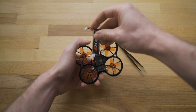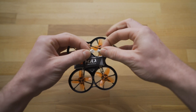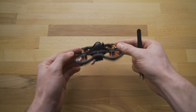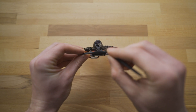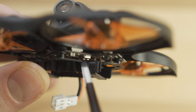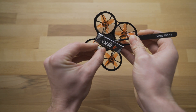Now we'll just want to put the battery in the drone — it makes it a little bit easier instead of trying to hold all these separate parts. Push it in and line up the contacts of the battery with the drone, but don't actually power it on. We just want to get it in place so it's easier to push together with one hand, because the other hand is going to be holding the bind button. To find the bind button, look at the camera or the lens — it's on the bottom right side. You can see there's a small whitish square with a black button on top of it. Put your flathead screwdriver or tweezers in there, make sure that button is pushed down, and then go back to the battery and connect those contacts now.